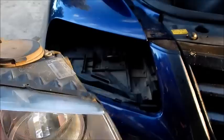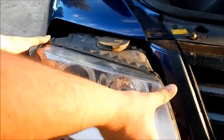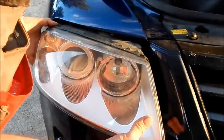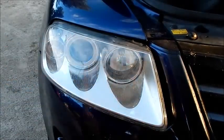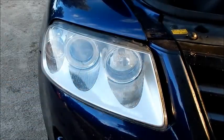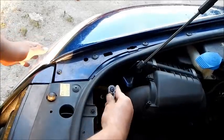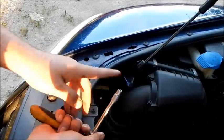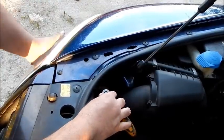We are finished with replacing the light bulb and have reassembled the headlight. Please pay attention to the distances left and right so that the headlamp can be mounted straight. I now carefully push the headlight back to the stop. Please do not use force. I again place my ratchet with the 6mm nut on the pin of the headlight and turn carefully to the right until the headlamp has moved completely inwards. Please do not tighten with full force as otherwise the headlight's gears will be damaged.